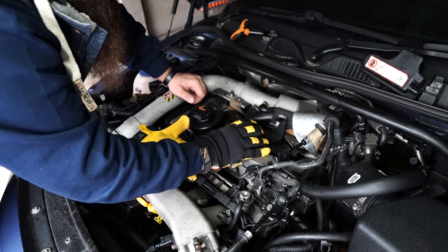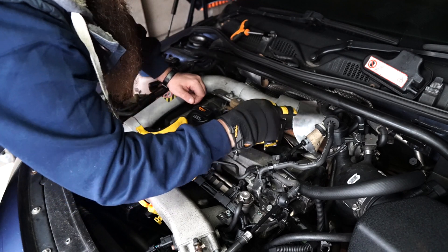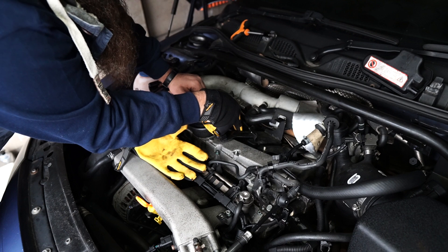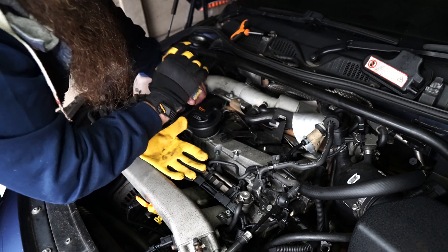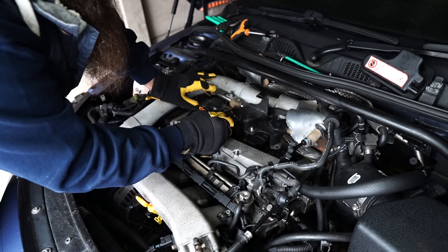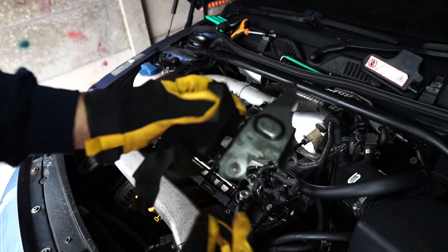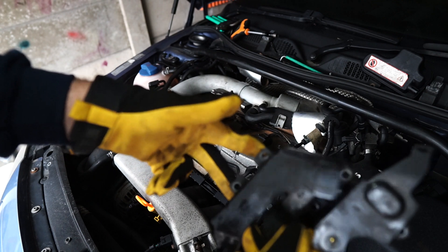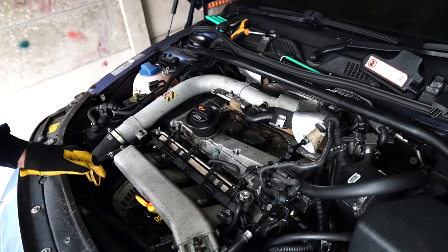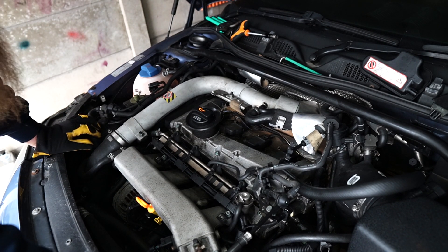To remove this bracket it's held on with Allen key bolts — there's one at the side, two in the middle, two at the other side. Now these two are already missing, so someone saved me half a job. I've just got to do the two in the middle and the one at the side. Bracket's removed — you can just lift that away. You've got positions one, two, three. Put it somewhere safe if you're going to keep it — if not, weight reduction, a couple of hundred grams.